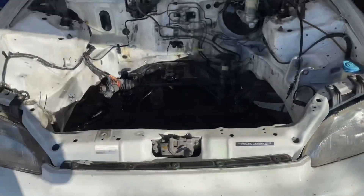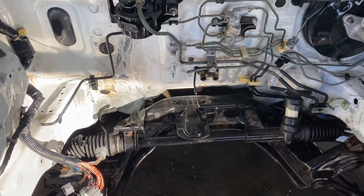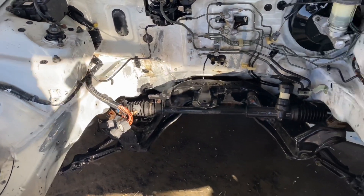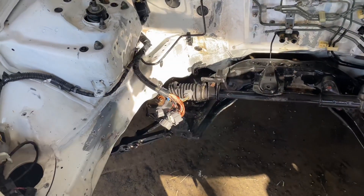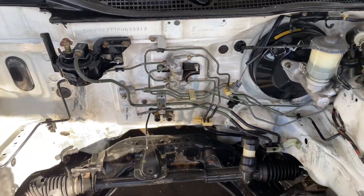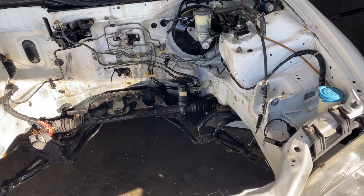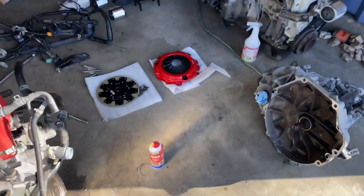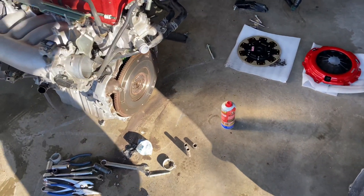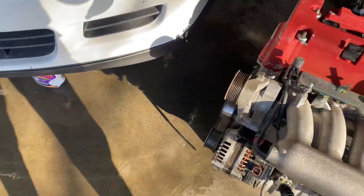We are back now and we can go over everything we've done so far. We got our battery tray out with the battery, our bracket taken off so we can install our Hasport bracket for the K-series. I went ahead and took off the slave cylinder and clutch line — still have to do the other half. I also took off the little solenoid that was right here and did the first cleanup. Next thing we're doing is getting the clutch installed — I took off the old engine harness and got the transmission and motor separated so the new clutch can go on.